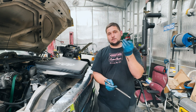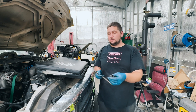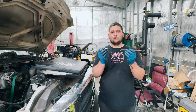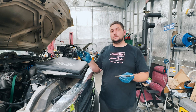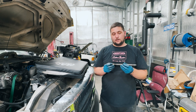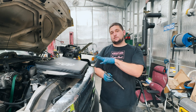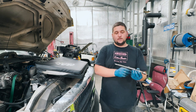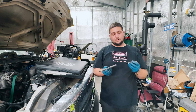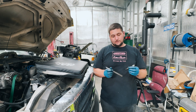This right here is what we call your dummy plug — it goes on the front of the high pressure oil rail on the 6.0s. I hardly ever see these o-rings fail, especially with this updated design. I can't tell you the last time I had to change one because they failed. When you go under there obviously replace all the o-rings when you take it out, but the dummy plug is the least common leak. It's usually from the stand pipe. Another thing with the passenger side failure rate is how hard it is to install — you can't put the stand pipe in in one piece because of the HVAC box, so you have to split it and put it in piece by piece, which is probably one reason this side tends to be the most common failure point.